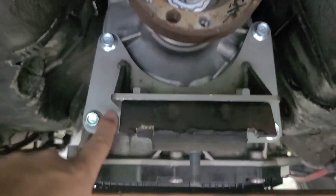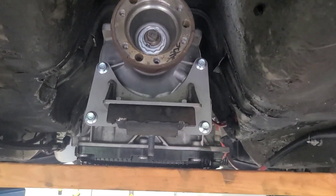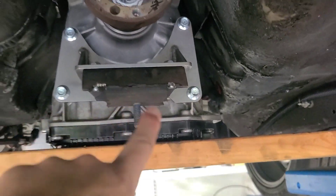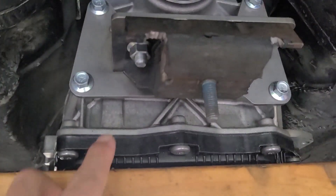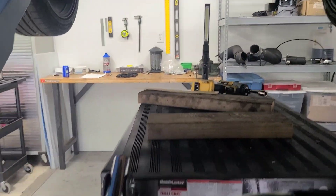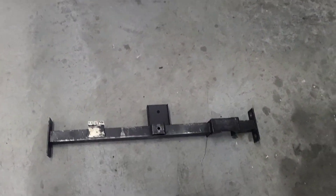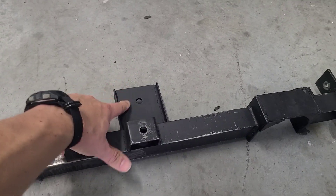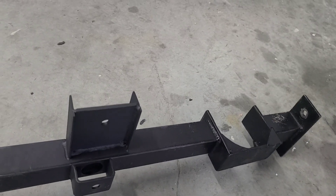Here on the back of the transmission you can see the plate that I bought from Summit — Hooker makes this for some sort of a Dodge muscle car swap for this transmission and it bolted on great. This right here is a GM rear transmission crossmember that I was using on my 4L80 — I did have to oval out one or both of these holes just a tiny bit to make it bolt up. Then I took my 4L80E crossmember and modified it. All I did was weld on this extension so that that GM mount can just slide right down through that hole — I built this box, welded it all the way around, and made it as strong as I thought it needed to be.